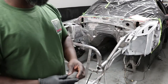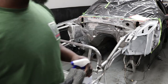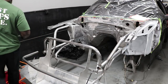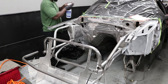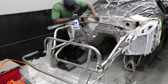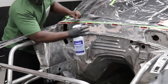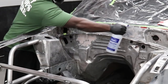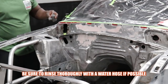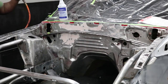I went ahead and got some spray bottles from Lowe's and did a 50/50 mixture of the KBS Clean. I got some warm water mixed up with the KBS and some clean steel wool. We're going to start at the top and clean it all the way down. Spray it on liberally — you can already see grease coming up off the surface. The key is not to let it dry on, so I have another bottle with just water and I'll use air pressure to dry it. I've cleaned the main part of the engine, so now let's use compressed air and dry it off.